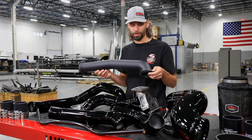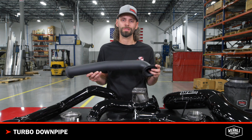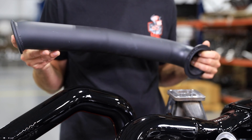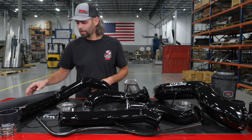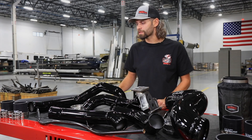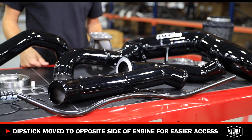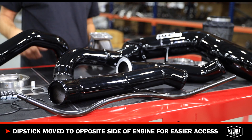One of the last few items in the installation kit is our turbo downpipe. Whether you're doing the S300 or S400 kit, they're very similar — the only minor difference being the size of the exhaust flange at the turbine housing. Both downpipes use a V-band style connection at the bottom which allows you to connect to your exhaust system just like factory. Heat wrap and hose clamps are supplied so that you can heat wrap that downpipe. Lastly, we supply a driver's side transmission dipstick tube. One of the issues with installing these upgraded turbochargers on earlier model Duramaxes is that the dipstick tube is on the passenger side and causes a major clearance issue with the larger downpipe. What we supply with the kit is a driver's side relocated dipstick that moves it to the other side of the engine, making it easier to access and easier to install that downpipe.